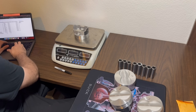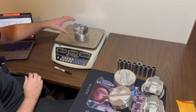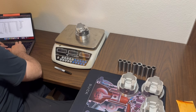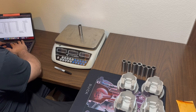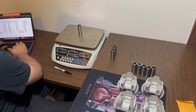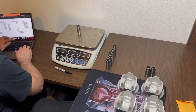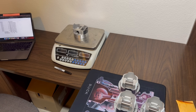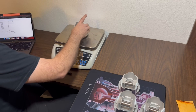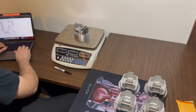Piston weights without the pin: 500.9, 500.2, 500.6, 500.4, 500.0, 499.6, 499.2, 499.5. Now the pins: 132.7, 132.7, 132.8, 132.8, 132.6, 132.7, 132.7, 132.7, 132.8. With the pins only being 0.2 grams off, mixing and matching them really isn't going to get us anywhere, so I'm just going to put them with a piston and do our balancing from there.